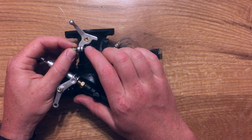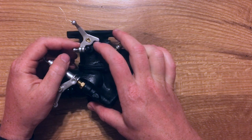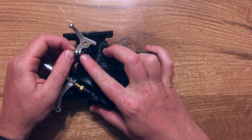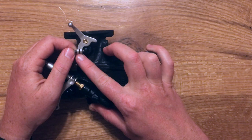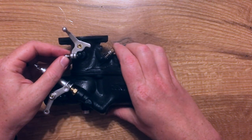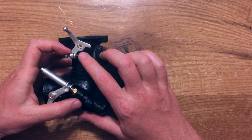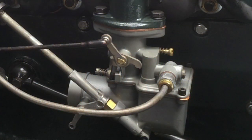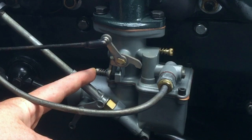So you have to calibrate this. The way to calibrate it is to run the engine up to operating temperature — you don't do this when it's cold, get it hot. Then with the carburetor on the car, you adjust this screw. Start by adjusting it out, getting that gap smaller and smaller until the engine starts to falter and die on idle, because that little hole is getting completely blocked. Then adjust it back in until you get a smooth idle. What you're doing is setting the absolute minimum amount of throttle applied to the car. The Marvel carb on my coupe has a similar setup with a throttle stop right here.